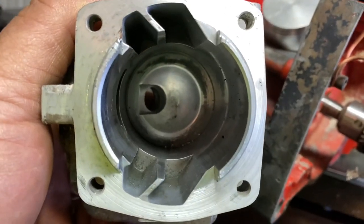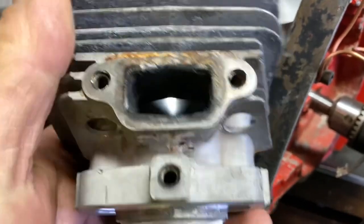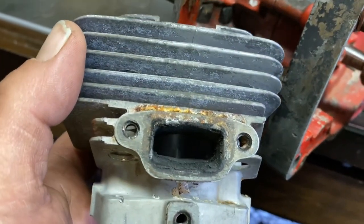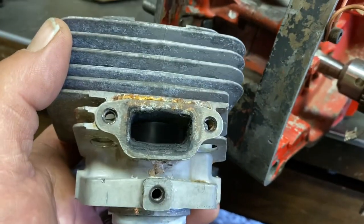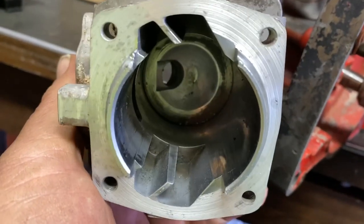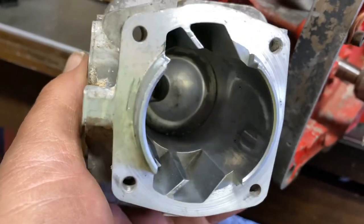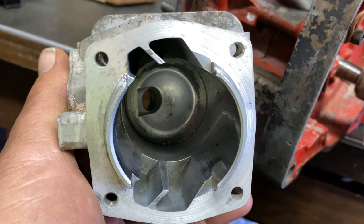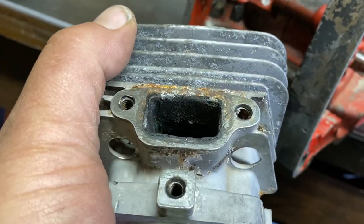These are open transfers, so some things are easier to do here. It's kind of common knowledge that it's better to widen the exhaust before you raise it - if you widen it you increase RPM but your power band will be broader and you'll have a little more torque. You get a similar effect by raising the transfers: you go higher and you kind of lose some of that broad power band. You're actually better off to go wider before you go higher, but it's hard to make those decisions before you know what the limitations are.